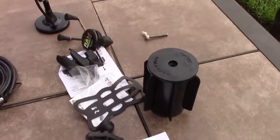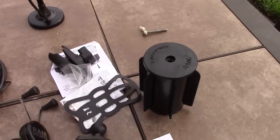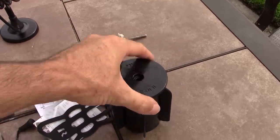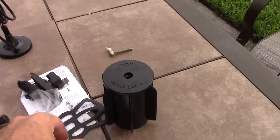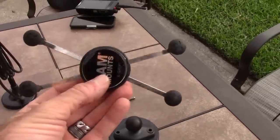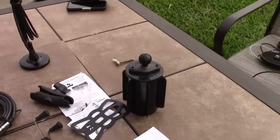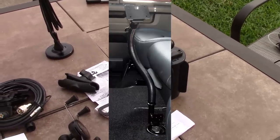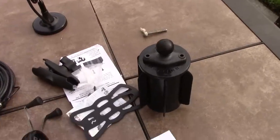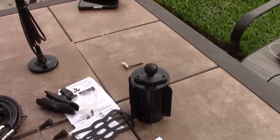What I chose for my head unit — and we're going to do that install first — is the RAM mount cup holder style mount, called the RAM-A-Can. This is pretty ingenious. This is going to go in my cup holder; this screws to the top of it. Then with the swivel adapter, I have my ID-5100 screen here — that's going to hold the screen where it's in reach, low so it's not in my windshield. There are other options like seat bolt mounts and glass style mounts that hold it on the windshield. I chose this one because I could easily pull it out and move it from vehicle to vehicle — every vehicle has a cup holder. I don't have to unbolt a seat mount, and it keeps it very tight so it's not going to bounce out.